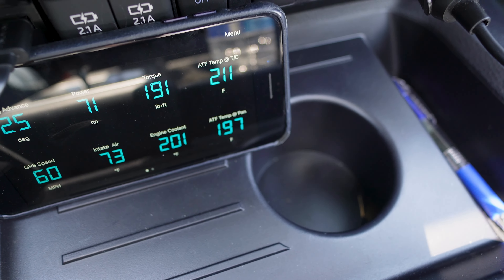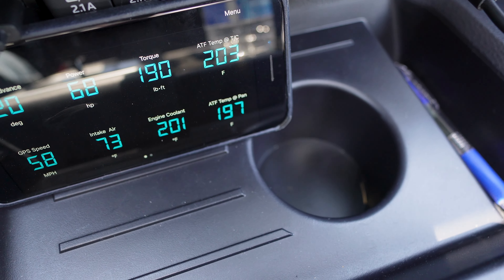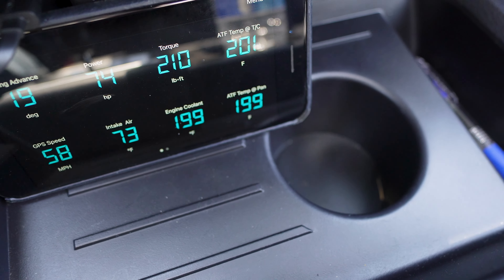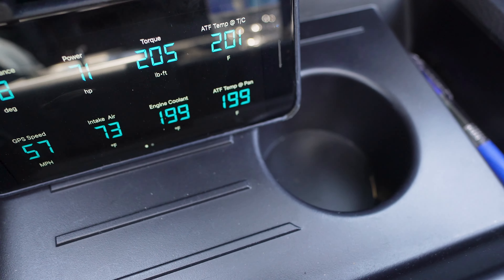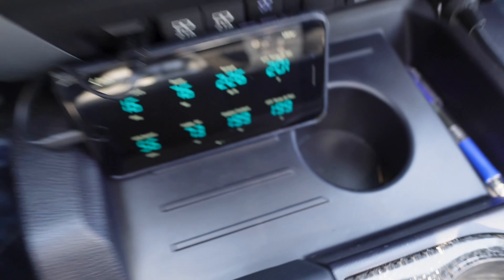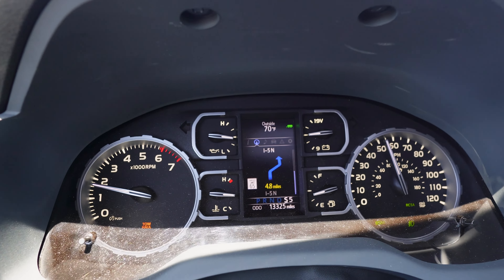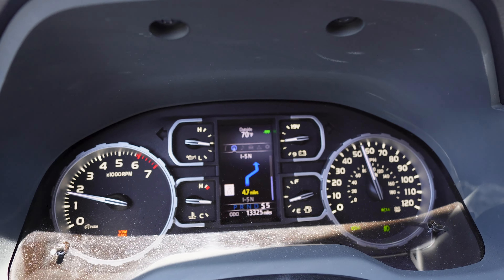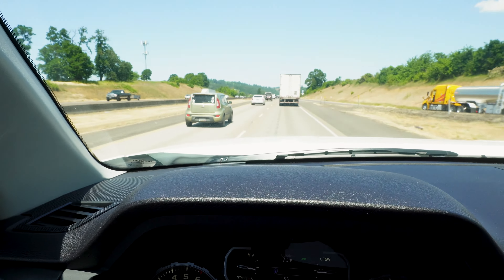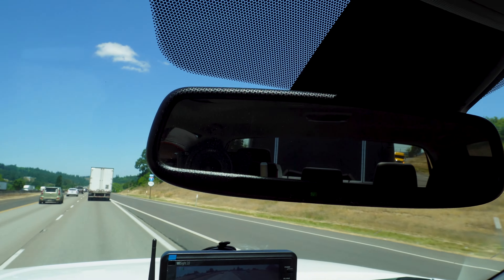It's right around 200. Now if I was to unlock the torque converter by giving it gas, you'll see it go up — 203, 205, 208, and I just let off — 210, 211, 213. And almost immediately you'll see it go right back down once the torque converter locks. Torque converter's locked — 210, 208, 205, 204, 203. The temp is still 197 in the pan and the engine's 199. So torque converter locked is super, super good to watch out for — it keeps your temps in check.